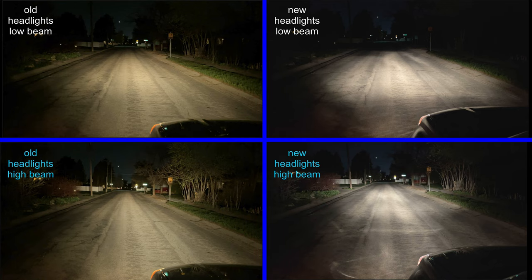In the lower left corner we have the old high beams. The light is smooth and even and you can see far down the street. With the new headlights, the beams are dark near the car with some weird horizontal lines. You can't see the sidewalk and the beam is concentrated in one spot on the road instead of being spread out evenly. The aftermarket headlights are much worse than the original headlights. You get what you pay for. If you want to be able to see at night, buy Toyota parts instead of cheap imitations.